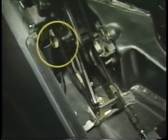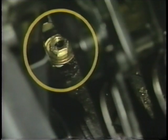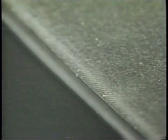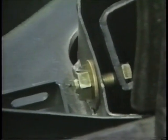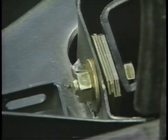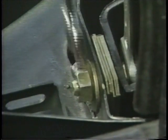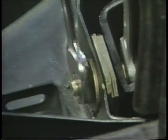When fitting the frame, carefully position the holes provided on the left and right over the studs. Do not initially fully tighten the fastening nuts so that the soft top can still be moved. Close the canopy. Check to see if a gap is open at the front fastening. Compensate for the difference with 1mm thick shims. Now tighten the bolts of the three attaching points.